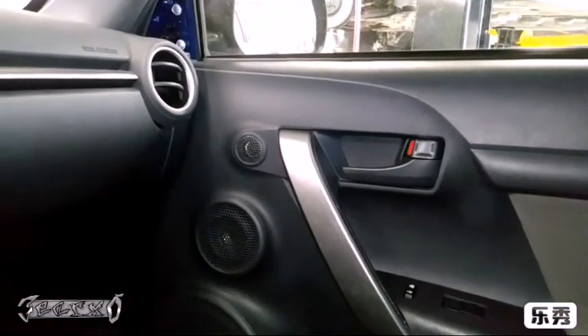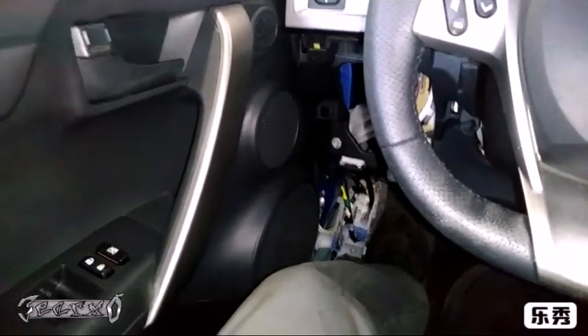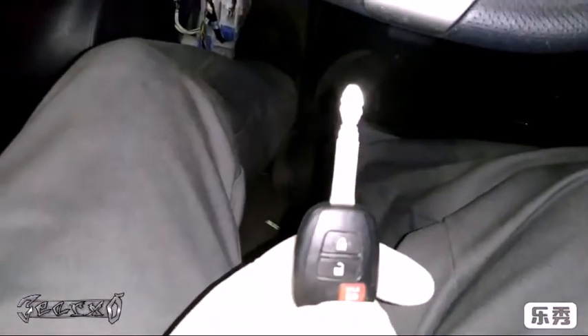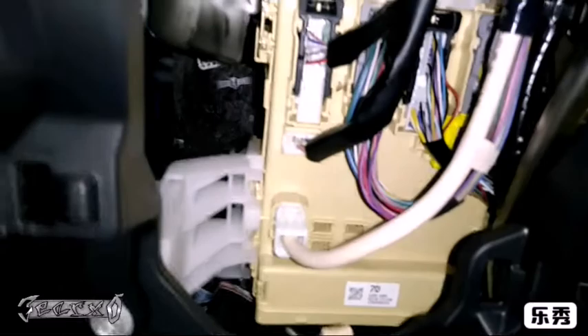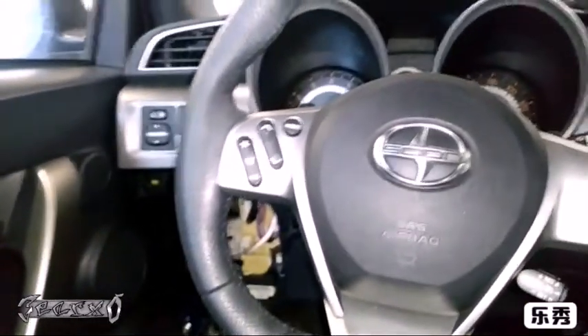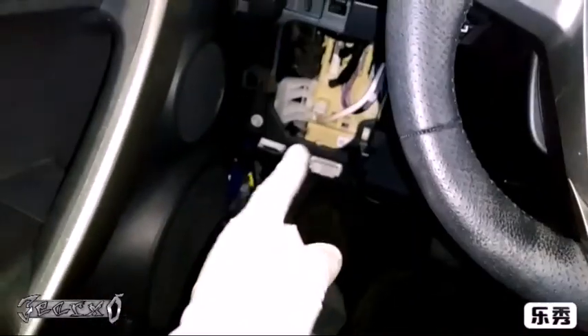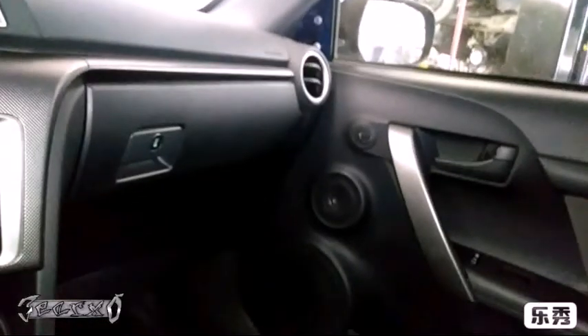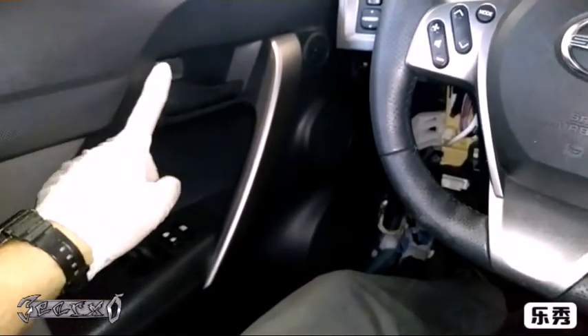On that side you can see it's working - lock, open - but this one is not. I tore apart the whole dash and door to find I was wrong, and I found out a few tricks. Number one: take your key and hit the lock and unlock button. Listen for a click down here - this thing has the relay in it. Hit lock and listen. That's the relay clicking. Also if your outside lights or blinkers flash, that means your key is communicating. The relay clicking is another thing to check, and if one door works and the other doesn't, that's also a good indication of a bad door lock actuator.